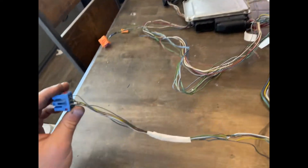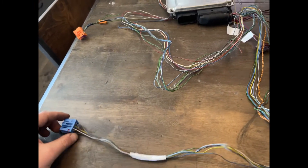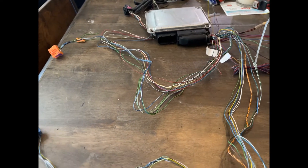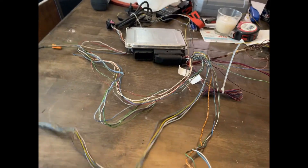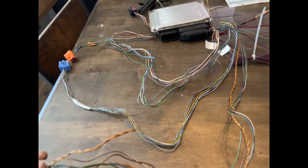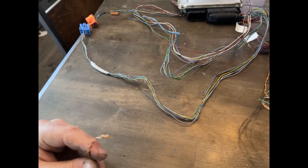The blue connector is the foot pedal. The factory wiring harness comes tangled up — the blue pedal and black pedal are intertangled — so I just cut one wire and re-spliced it so it could route wherever I needed. You'll notice there are two orange and white wires; one twisted orange and black pair leads to the ECU and the other leads somewhere else. Don't cut the one that goes to the ECU — keep that wiring harness intact.